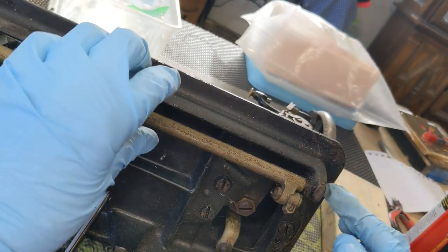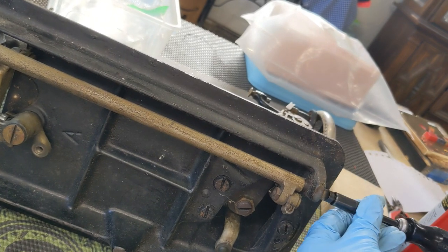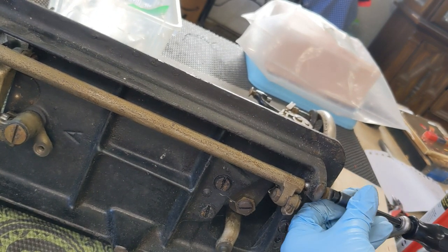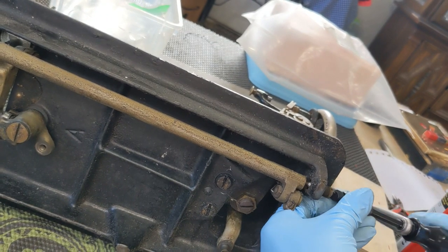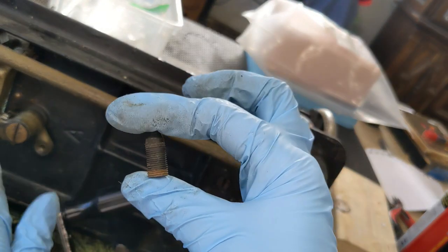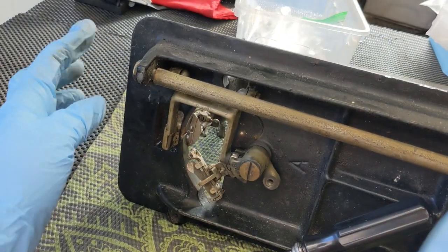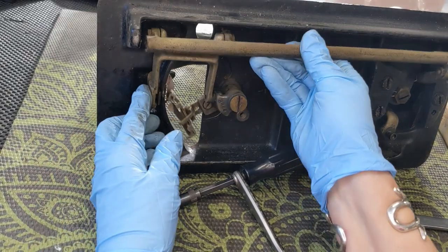My nut is off. There is still a screw in there, so I can put my screwdriver in now and release it. You will see this pivot point screw is really, really filthy. That is what it looks like — terribly filthy. But that is okay, we can clean it up. I am going to go ahead and take that same one off of this side. Now that those are off, you can see that this shaft is moving pretty easily.